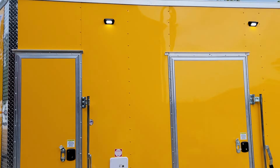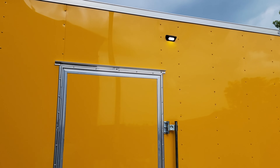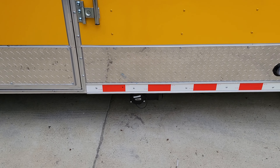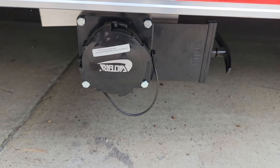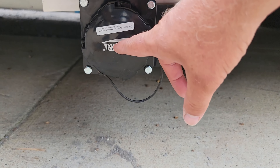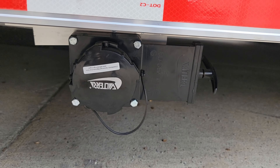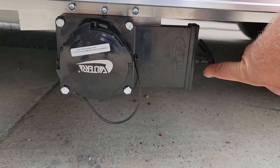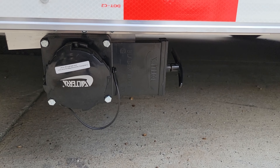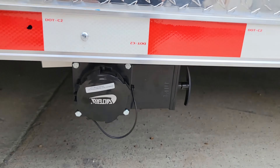You can see here you have an LED light in between the two doors and then one just to the right of the main entry door. We have the 36 by 78 inch main entry door. Coming on around here, down here at the bottom this is the waste tank drain. To use this, simply remove this cap — twist it off — connect a three inch hose to it, available at any RV and camper store or through Amazon. Once you've hooked your hose up, grab this handle, pull it out — that opens up the valve allowing the contents of the waste tank to drain out. Once done, close this valve by pushing it back in, detach your hose, and replace your cap.